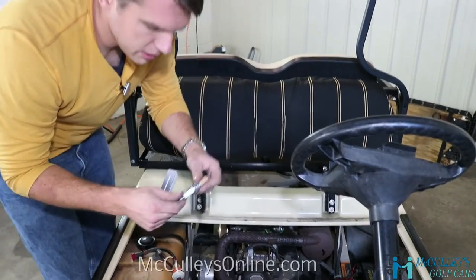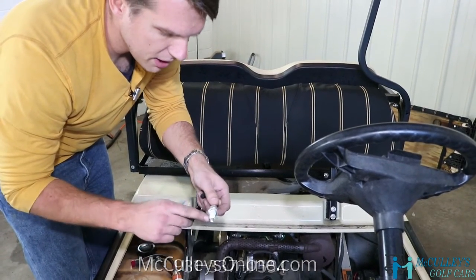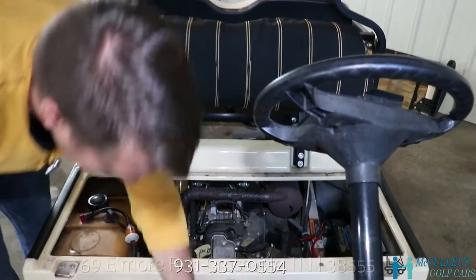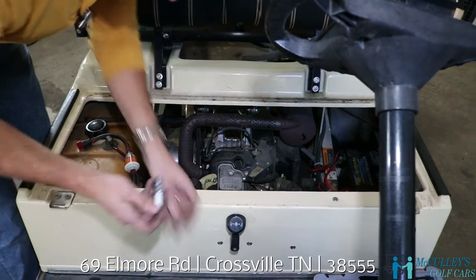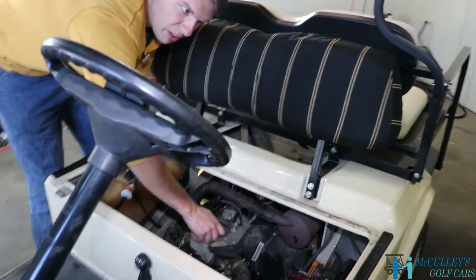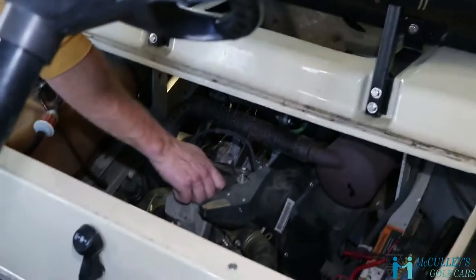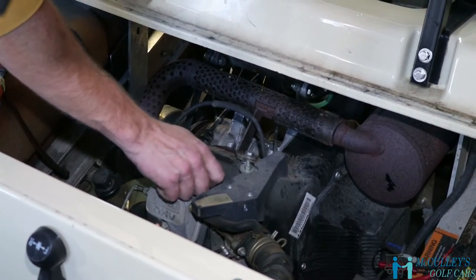All right, actually earlier I gave you the wrong number. I pulled the wrong spark plug for this job. It's actually the BP4ES spark plug. But anyway, so we're gonna take the new spark plug and make sure it threads in very easy. If not, you really don't wanna cross the threads on the spark plug. So you should be able to screw it in a really good ways just with your fingers.